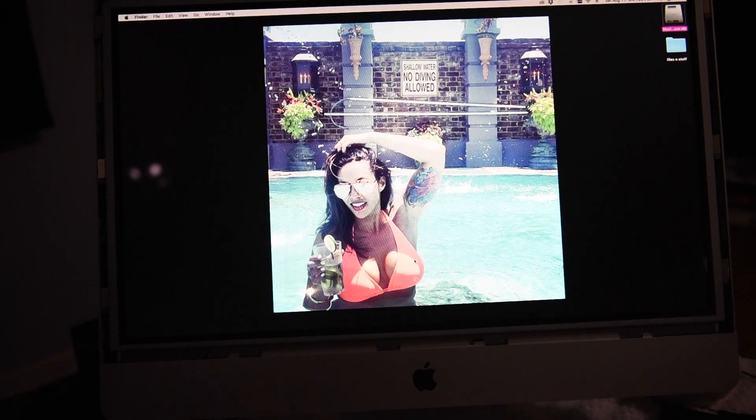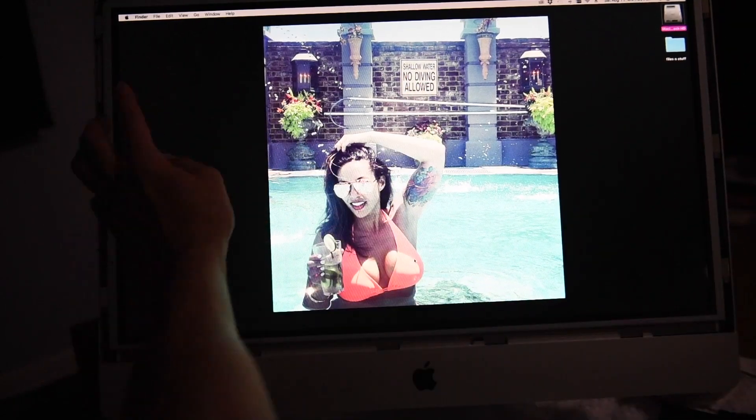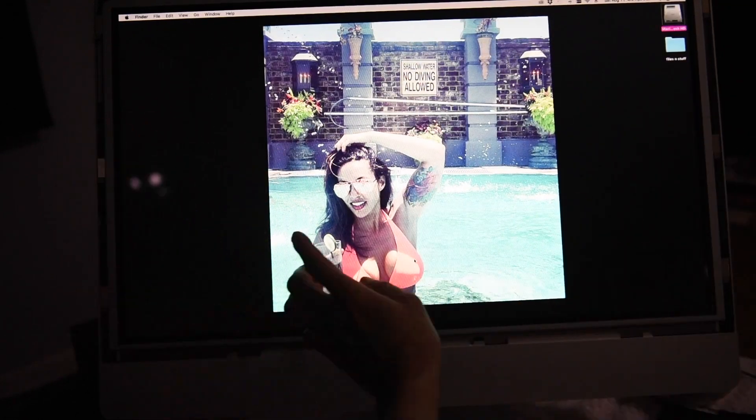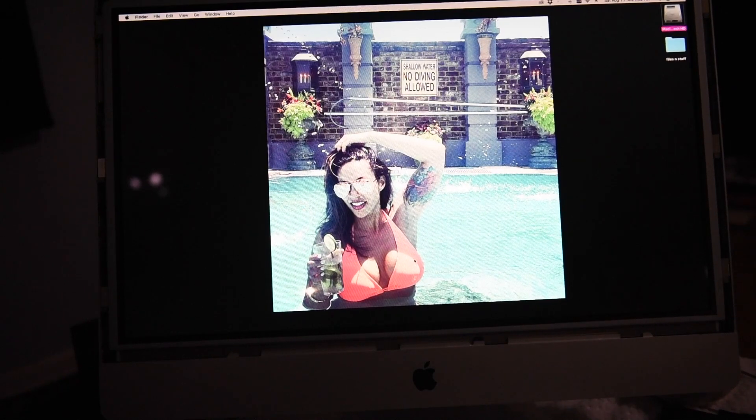There are screws around the outside part of the screen — about seven to eight screws located down the right and left sides. Do not mess with the screws on top; you don't need to take those out, just the ones on the sides. You'll also notice there are magnets which help hold the outer protective screen on. Take your time with this because the screws will get stuck to those magnets. A magnetized screwdriver helps keep the screws from falling out.